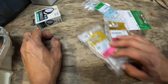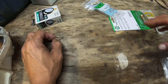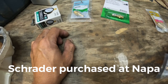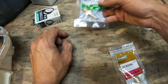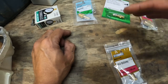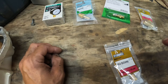What I'm gonna build here is a pop-off tester for testing carburetors like Mikuni carburetors on jet skis. What you're gonna need is some type of Schrader valve. I could only find an eighth inch Schrader, so I've got an eighth to quarter bushing, a T, a quarter to quarter hose barb, and a short piece of fuel hose. I also have a gauge here.